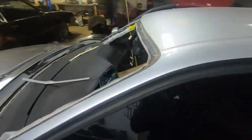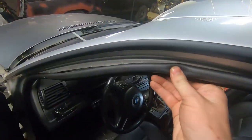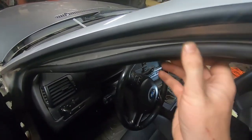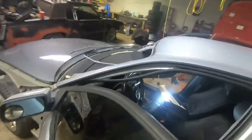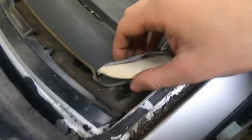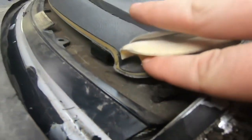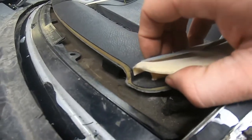If you want to make it a little easier on yourself, you can come under here and pull this rubber down. It's pretty easy — it just pulls off because it clips over that a little bit. I've done that and now the top part will just kind of remove itself. The only other thing you have to undo is down here — there's a little clip there. Take a slot screwdriver and pry the rubber from the dashboard towards you to unclip it and then pull it out.